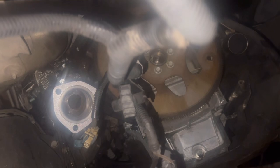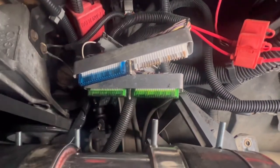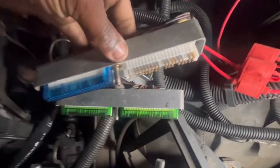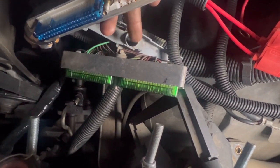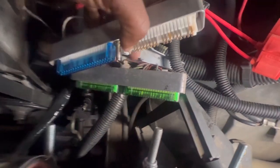For the next video, we're probably going to be removing that flywheel and probably doing a new rear main seal — we need a flex plate. Now we're up top. I'm going to remove this white wire, which is in the blue connector, number 79, and we're going to put it on the green connector, spot 22. If you have an 02 model or below, your connector might be red, but it's still going to be the same number concept.